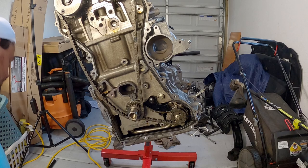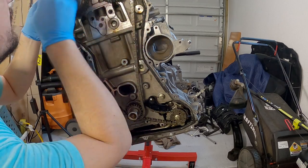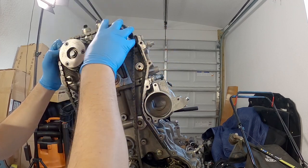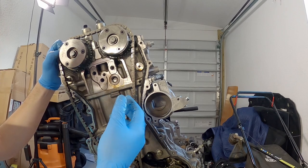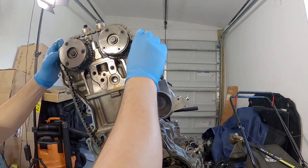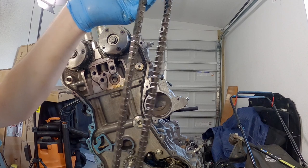The next thing we need to do is remove the timing chain, the guides and whatnot, and then work on taking the oil pan off. Springing back Cobra days — except a lot less silicone and a lot more timing chain. What I find weird on the EcoBoost engine is there's no timing marks on any of the gears. On the Cobra it's easy — there are markers on the teeth of the gears and crank sprocket, and a link in the chain that's a different color. On the EcoBoost they don't have that — you have to manually time the whole thing. Taking a look at the timing chain, it actually looks pretty good. Don't see a problem with that.